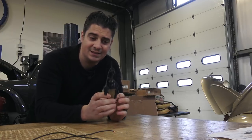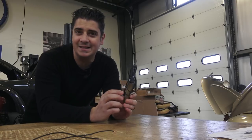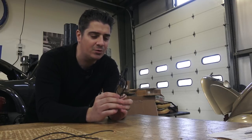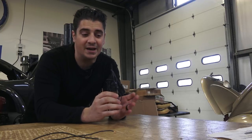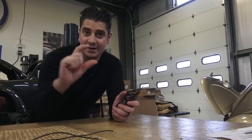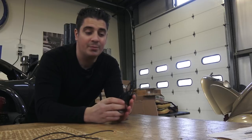It's a pretty quick and easy tip. You're going to get yourself a little test light like this. Hopefully you have a traditional bulb in there as opposed to the newer ones that have an LED bulb — they're a little too sensitive. Those LED bulbs can come on with almost nothing sometimes. Get one with a traditional bulb if you can. If not, you can always make a jumper wire to a small blinker bulb or something and touch the wire to the battery.